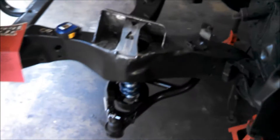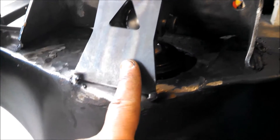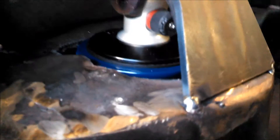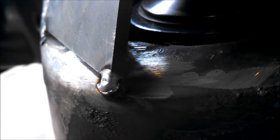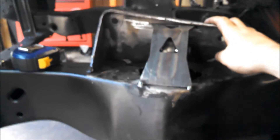I went ahead and tack welded the Speedtec mount — tack welded here and here. Looking at my tack welds, it looks like it penetrated a little over halfway through the metal. I don't know about the frame, but this is a crucial weld because it's suspension — and if this breaks at 120 miles an hour, that's bad news.